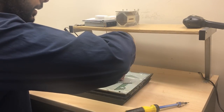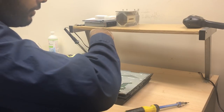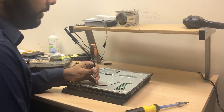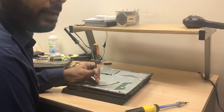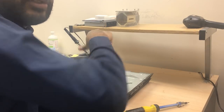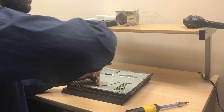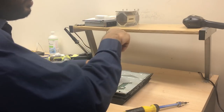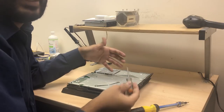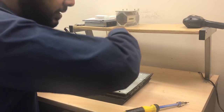Then we're going to go ahead and tighten these bolts. Now, if your console is really dusty, I would recommend cleaning out the dust — this one wasn't, so we're not going to do that. Also, in certain instances you might have to replace the thermal paste on the APU chip, but in this case it wasn't necessary because I don't see a lot of dust or heat buildup patterns. In certain cases I do recommend taking the motherboard out and replacing thermal paste when you're doing this, but in most cases it's optional.